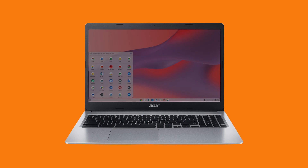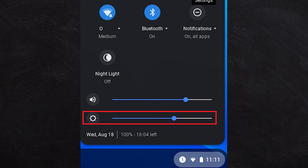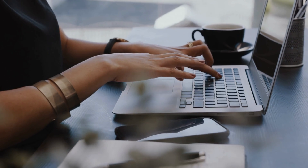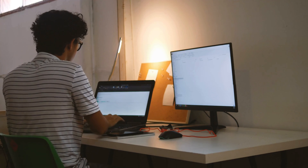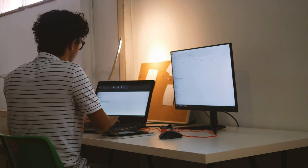Number four, let's talk displays. If your screen is blank, you may need to adjust the brightness — I know that sounds basic, but sometimes this happens. Check the brightness keys on the keyboard to make sure you've actually got the screen switched on and high enough to see. For further diagnosis, you could try connecting an external display via an HDMI cord — that's always a good idea to see whether the issue is with your internal display or something else to do with the computer's hardware.